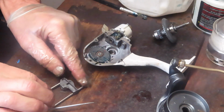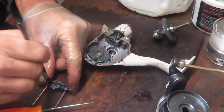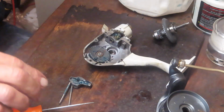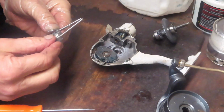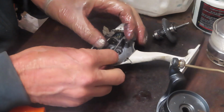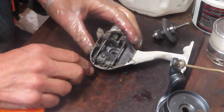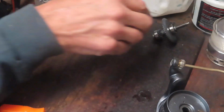Just like that. Next up then, we want to put some grease into the channel where this is going to slide. And you can get a light grease on these posts that they're going to slide up and down on. If you over grease it, it's just going to swing it out. So just be careful with that. Find your points that it rests in. Make sure that you're inside those two carriers, that you're in below, and that you're over the stud. That's the important part here.